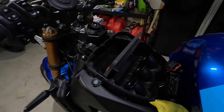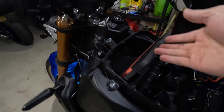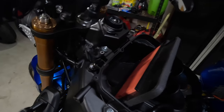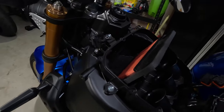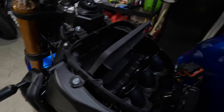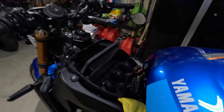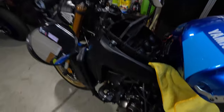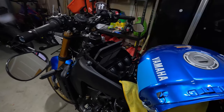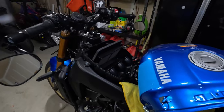Just like that, as soon as you remove those Phillips screws, the cover comes off and gives you access to the stock filter. All I'm going to do is remove the filter, put the DNA in, put the intake cover back on, put the ECU on, and then repeat all my steps in reverse order. I'm going to get this all wrapped up and in my next video I'm going to give you my first ride and impression of the DNA air filter with the new tune from V-CycleNut.